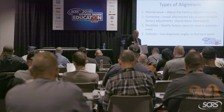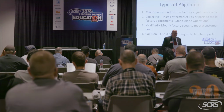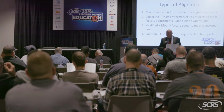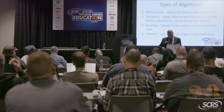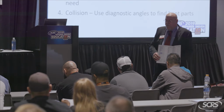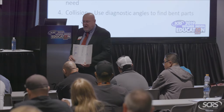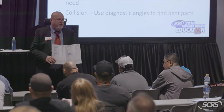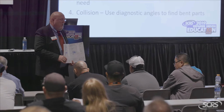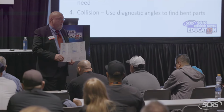What do you see the most of there, guys? Gray or blue? Blue, which means what? I like you said money. That's exactly the way I want you to look at it. You see, the average maintenance shop out there looks at that as a, oh man, I got to put a cam bolt in this thing? No, I'm just going to set the toe and kick it to the curb. So you see the total difference between a maintenance alignment and a corrective alignment.